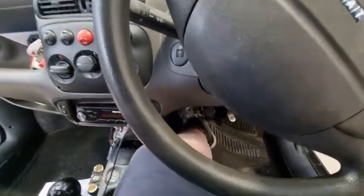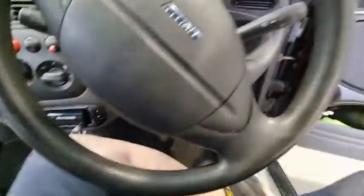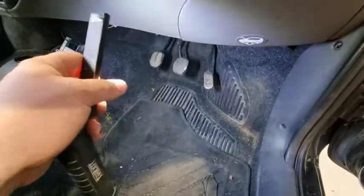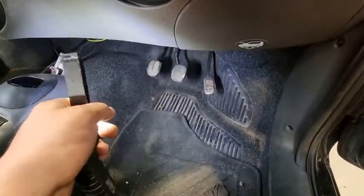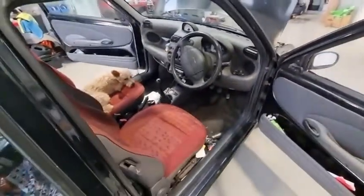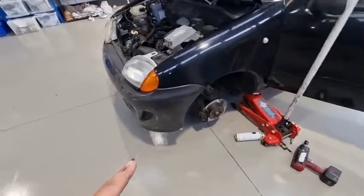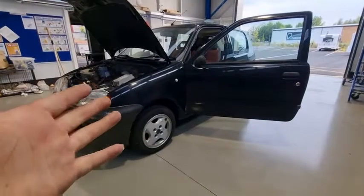What you find is the pedal will start to sink. The better way of doing it is you want the clutch pedal to be roughly in line with the brake pedal. Surprising how I can actually drive this car — all the pedals are quite close together, but I've been driving these for so long it's become second nature. I'm now going to put the wheel back on and put the airbox on, and just like that, everything's all back on where it's supposed to be.